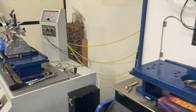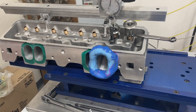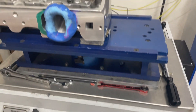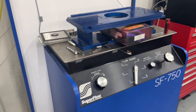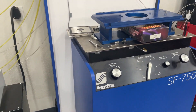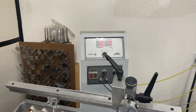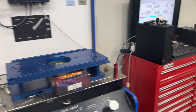It's not that this bench is bad — 55 inches is pretty good — but after all, it says 680, and that's at 28 inches of vacuum. You do 55 inches, you're going to flow less. You're like, why don't you use a SuperFlow? SuperFlow wouldn't even come close to this. I'll be lucky if I can get 40 out of that thing. Anyway, it looks like I'm going to have to stop there, but let's look at the results real quick.